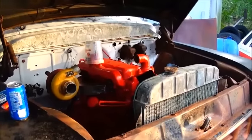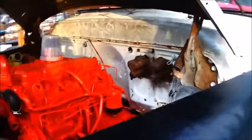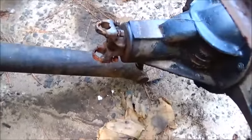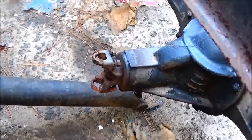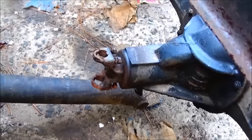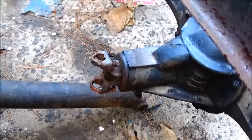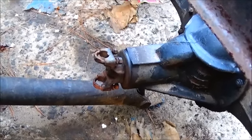I don't have the rear yoke yet for the driveshaft. I've got the driveshaft laying in — as you can see, it's just down there on the ground. It's longer than it needs to be, not a problem. I've just got to find something that has the right yoke and U-joint for that. I don't like using offset U-joints — it's just easier to pick up a regular U-joint. If one goes out and you need an offset where one cross is different than the other, they're hard to find.